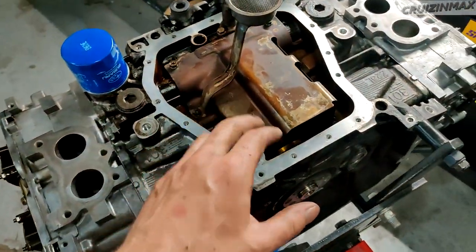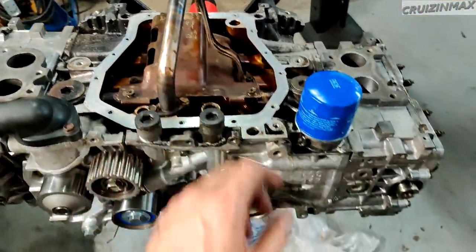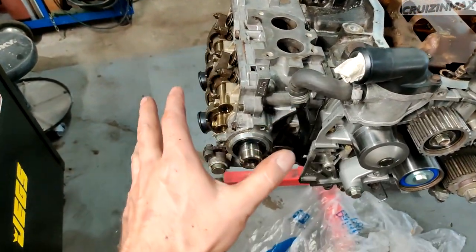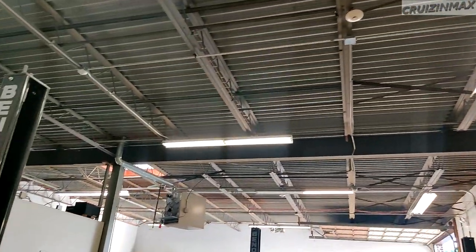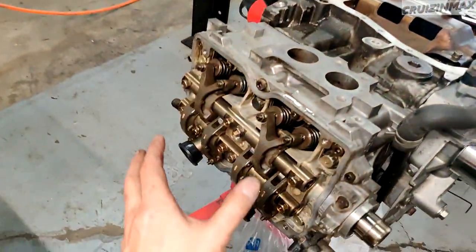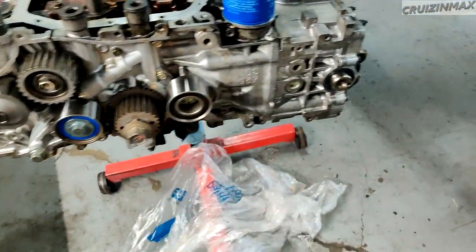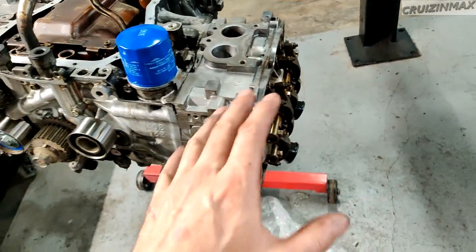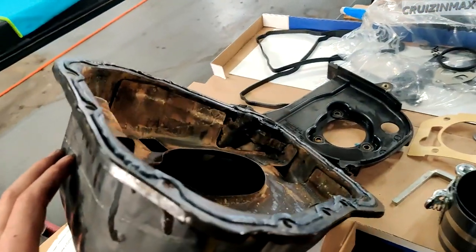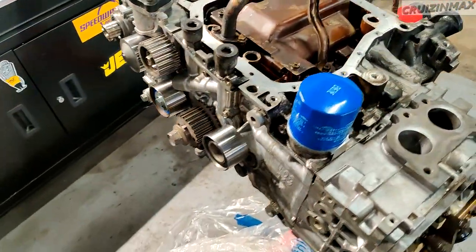We're ready to put the oil pan back on. Subaru filter, all this was cleaned. As you can see, the heads are on. Still you gotta do valve lash, but gotta do timing belt. You know, the valves gotta be at a specific spot so they're loose. This is drying, ready to go in. Moving along